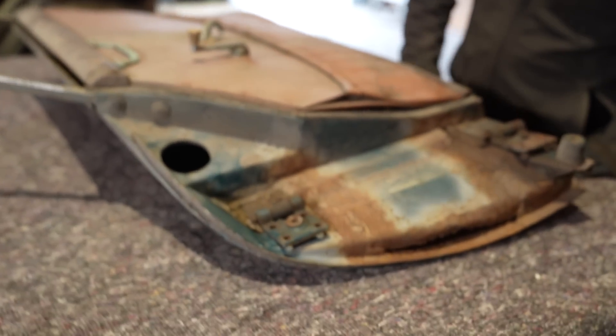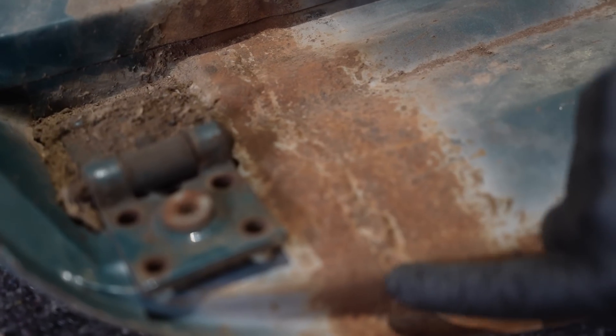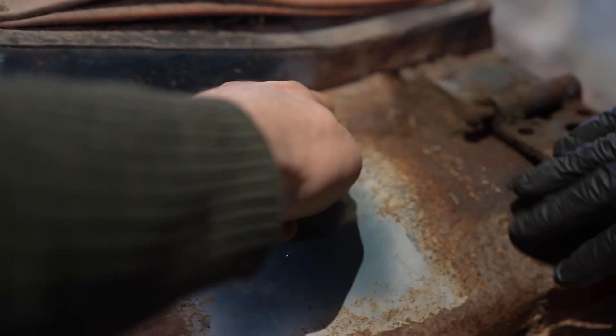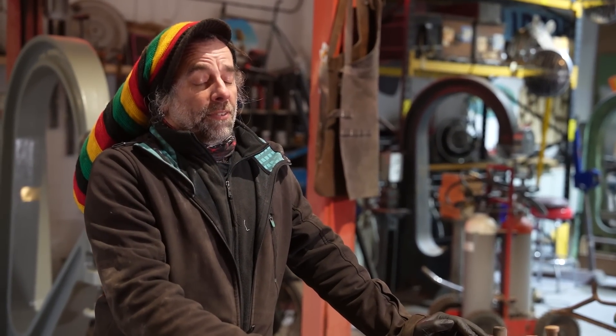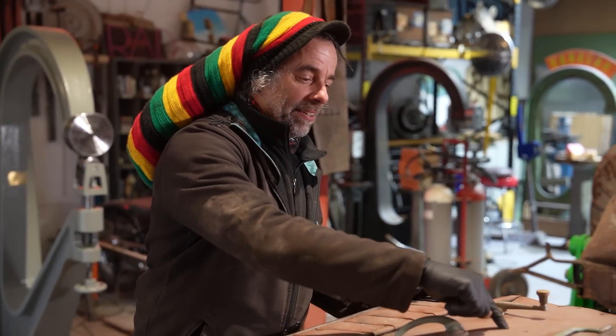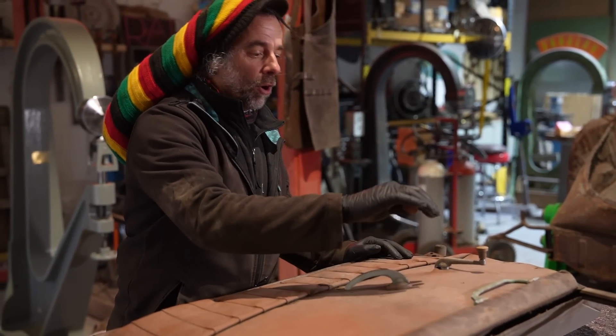John is hopefully going to tear it down carefully. There's a funny weld along there — and then back again, like they've cut it and peeled it back for some reason. Every panel when the car was made had a number stamped on it — the door, the bonnet, the engine lid. If they're all corresponding, Dom may have nearly a matching numbers car. The number will be around about this area on the actual door frame. If we can get this door card off we can see if we can find it.